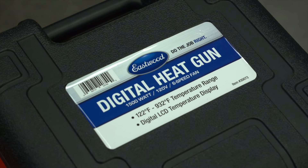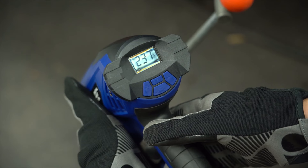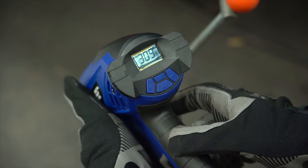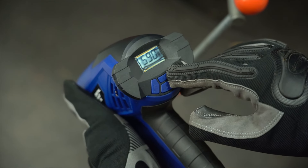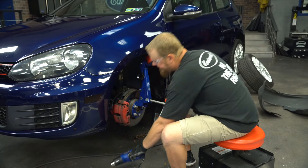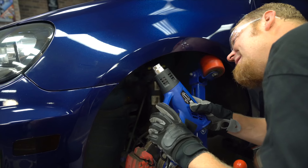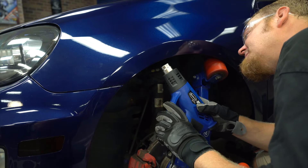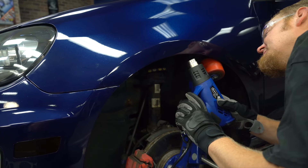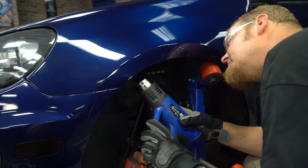I can't stress this enough — you want to make sure you have a heat gun on hand for this project. Heating up the paint isn't going to damage it as long as you're careful. We're using the Eastwood digital gun so we can set the temperature ourselves. You just want to heat that paint up enough until it's soft so that when you're working the fender, it's not going to crack and chip on you. Ryan set the temp to about 500 degrees — that doesn't mean we're hitting the fender at 500 degrees, but it limits accidentally going too high and burning the paint. If you have an IR gun on hand, that's a great idea to stay in the sweet spot. Apply a nice even heat across the whole fender, not staying in one spot too long — nice even passes back and forth — and then you can start rolling.